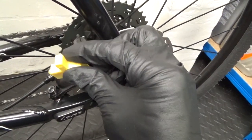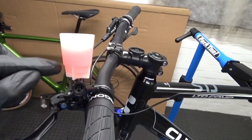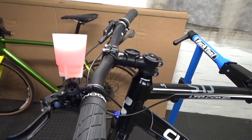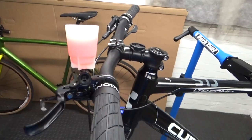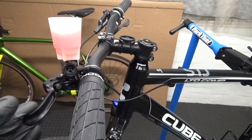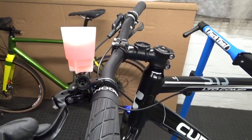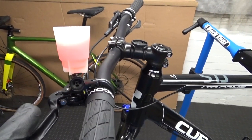Back at the handlebar end now. All I've done is remove the plunger out of the middle and put some Shimano mineral oil into the bleed cup. To bleed it using this method, I'll just pump the lever a few times to get things moving — and you may see some bubbles coming out into the cup. I saw about five or six bubbles just come out.